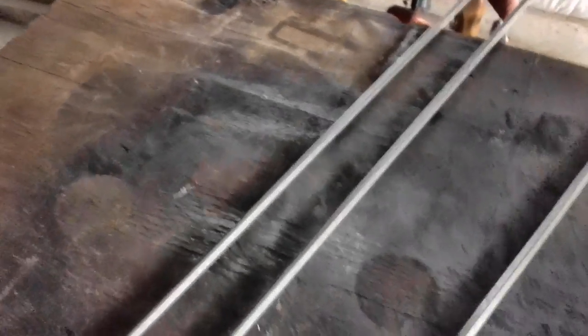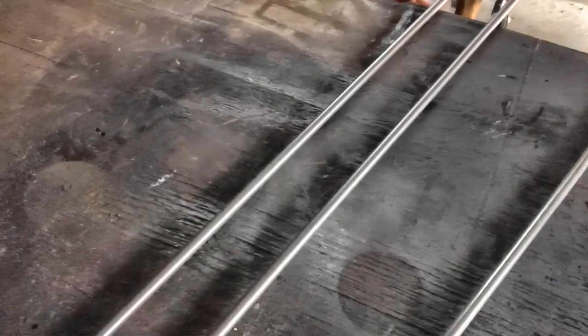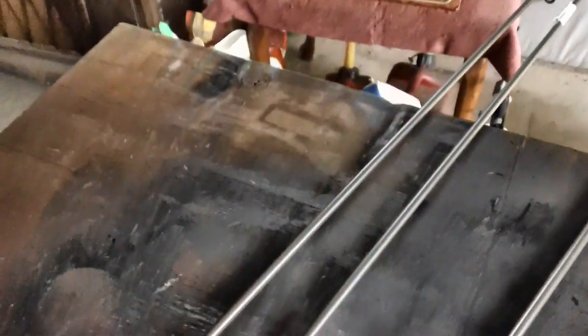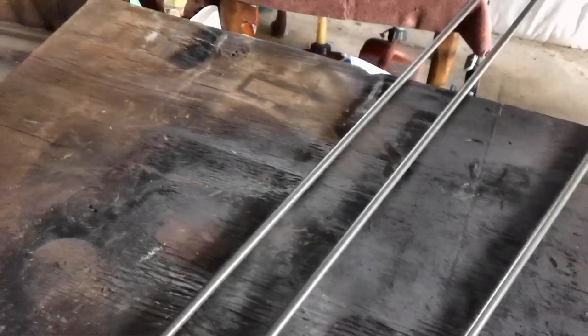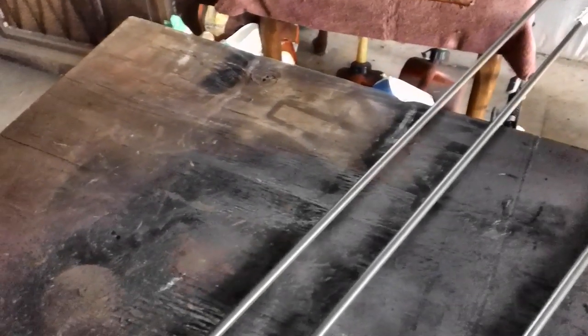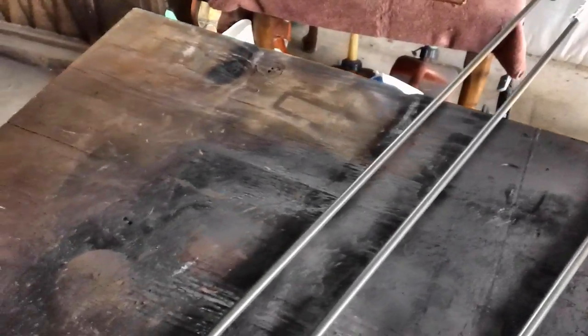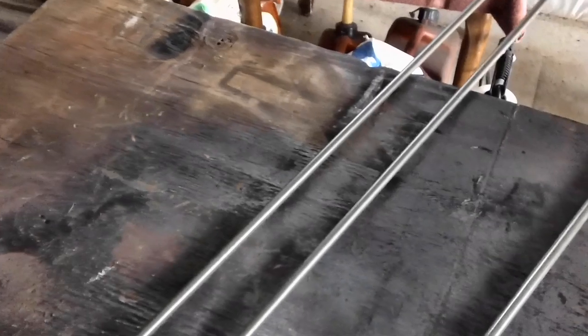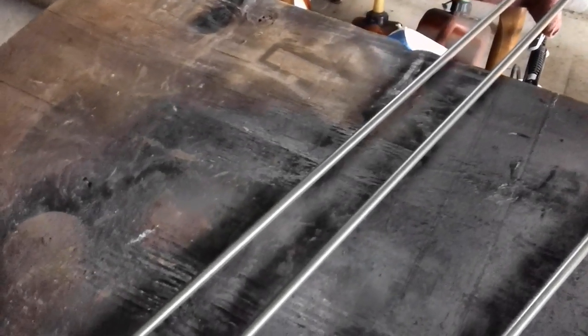And this line here, the one we tried to bend the other day, use sand, heat, whatever, you probably would get a good bend. This line here is a copper nickel alloy, and you can bend it by hand, and it won't kink. You can get it in large coils or rolls in copper color even, or just this color right here. And you can run a brake line from the front of the car all the way to the rear. Do it by hand, bend it over and around in all kinds of ways without using a bender. It's fantastic stuff. Poly Armour. You'll see when we get ready to do the gas line.